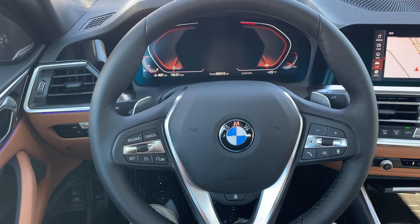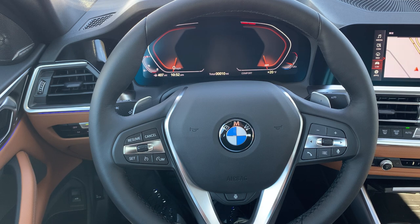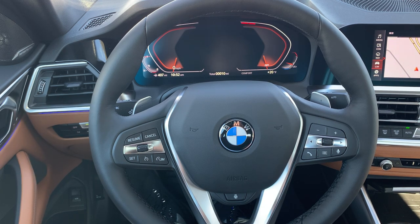If you want to control any other aspect of the live cockpit, you do have to go inside of the iDrive system under the settings, under the display settings, and configure that as you need to. Moving down below the second button there — that is referring to your automatic high beam function. Essentially driving at night with headlights on, pressing that second button automatically enables the auto high beam function. As a car is coming at you, it will deactivate your high beams until that vehicle or light source passes, and then it will turn back on again. So it does that automatically — very convenient.